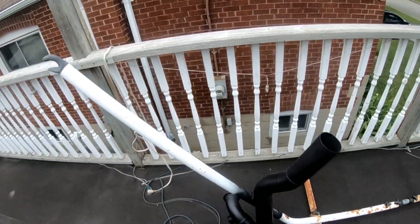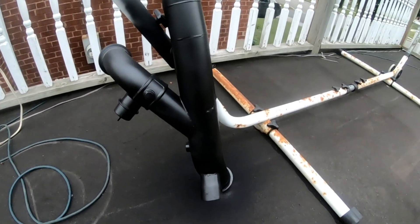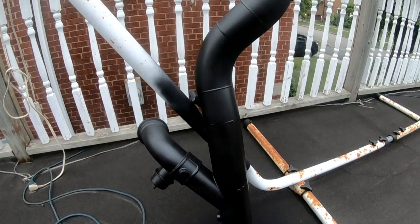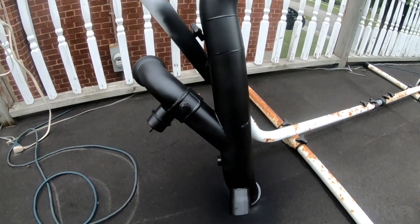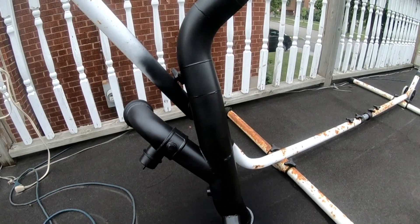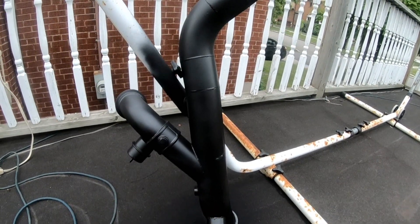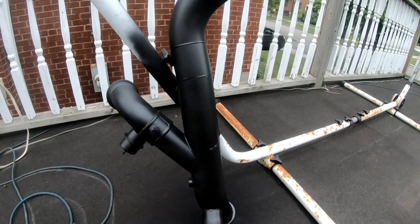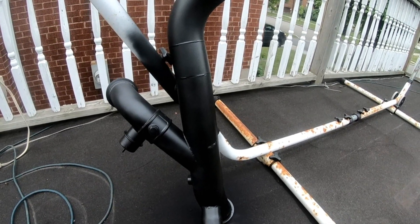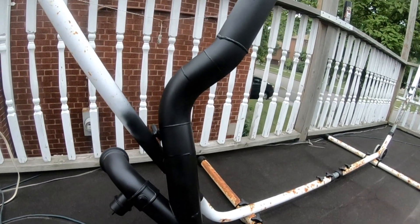I got my downpipe here — just spray painted it with some black ceramic coat, about three coats, pretty thick. Going to let that fully cure, then heat wrap it. I also bought some heat wrap spray to go on top, which should hopefully keep under-hood temperatures down. Eventually I might take off the mid pipe or crossover pipe and treat those as well, and if it ever came down to it I'd pull the manifolds off and do the same.